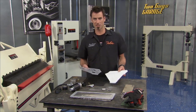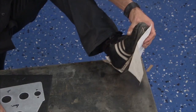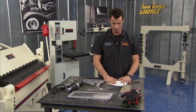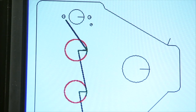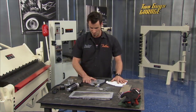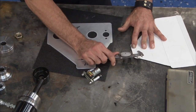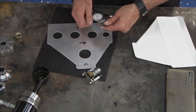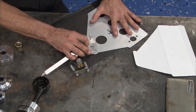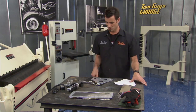Next mission: dead pedal. Do you know what a dead pedal is? It's where you have your foot up there and have nowhere to put it. We're also going to add a high beam indicator. We patterned it out in cardboard, scanned it, then put it into our Tracker CNC. Really quick and easy, simple way to cut it out of thin aluminum. I've got my piece back in aluminum, and I want to lay out my bending. Take a set of calipers, lock them down, scribe both sides, and label up/down/up — keeps you from messing up your fold lines.